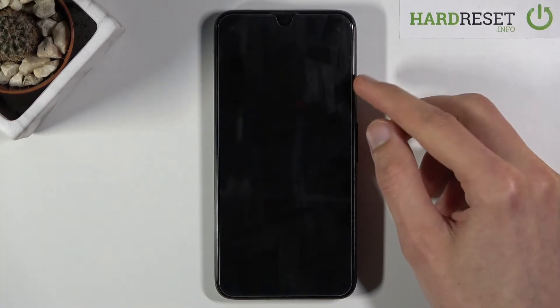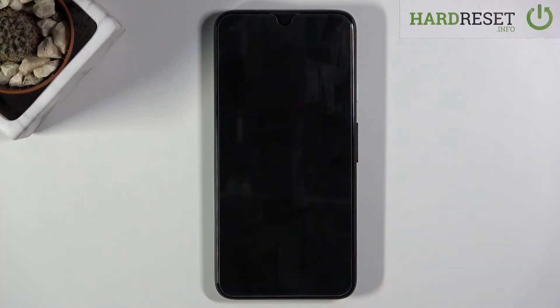Before I start, I'll mention that once you see the recovery mode or boot mode, you want to immediately let go of the keys and do it semi quick. There's a chance that once you let go of the power key, the phone accepts the release as a press and progresses further to reboot the device, because that's the first option that is selected.